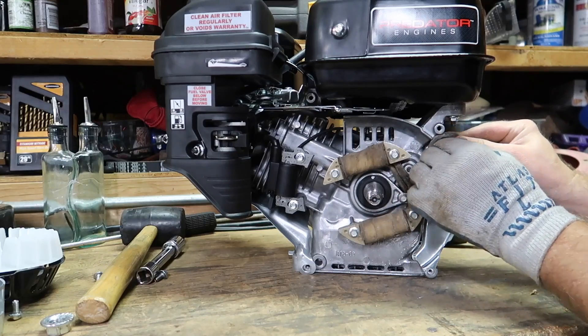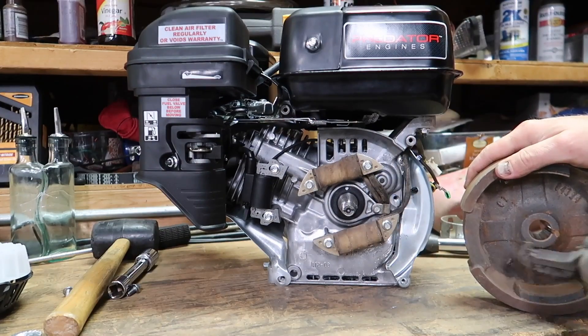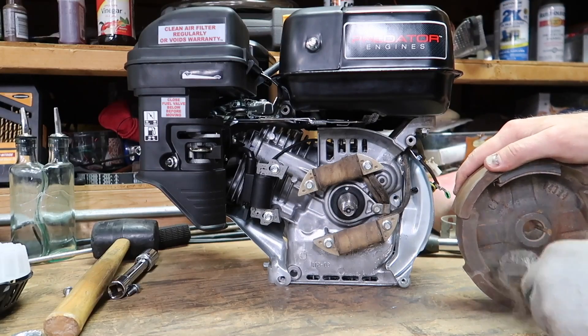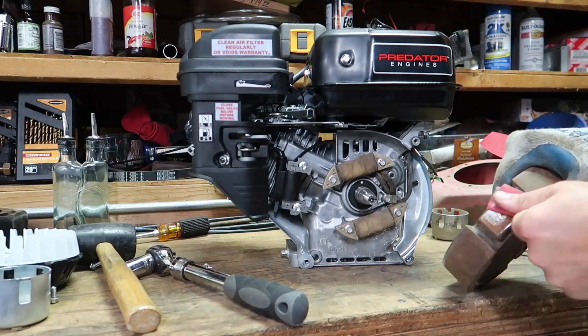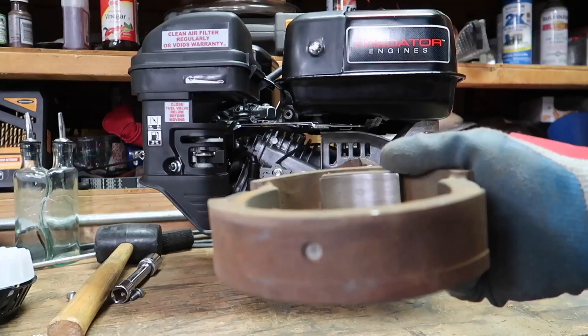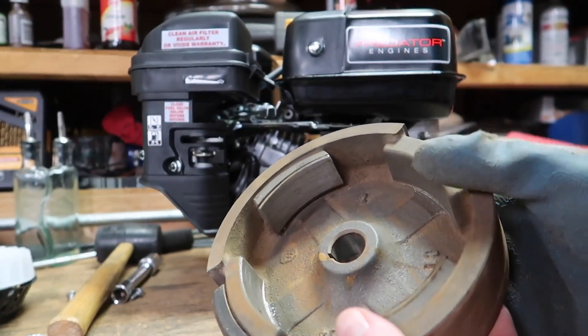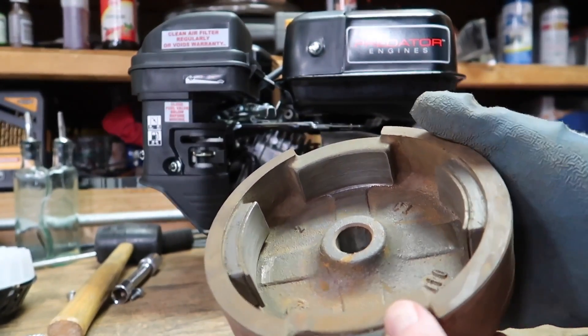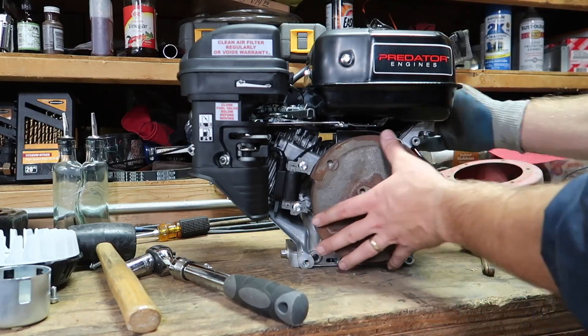There was a small gap right underneath the gas tank, so I fed the wires through there. The old flywheel was dirty and rusty, so I cleaned it with a wire brush and some sandpaper. Now that the magneto points are nice and clean, they should produce plenty of voltage to power the headlight. Now we just reassemble everything back together in reverse order.